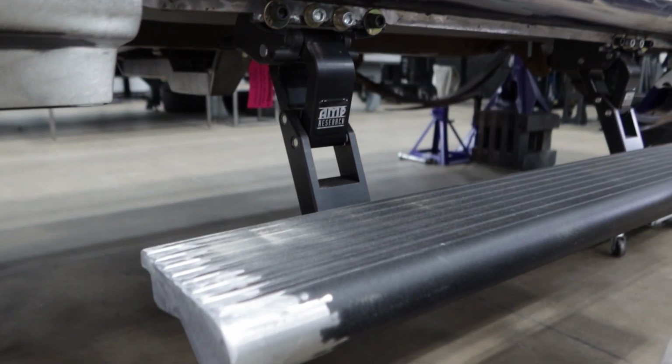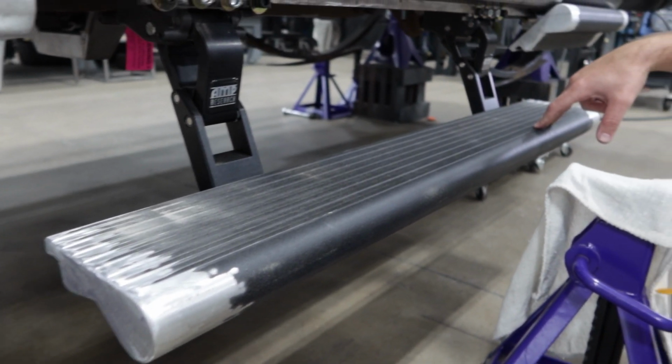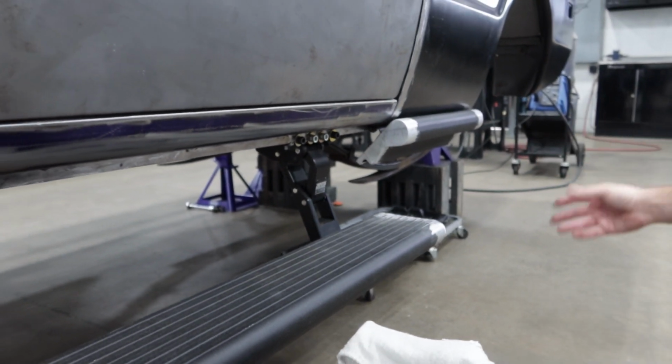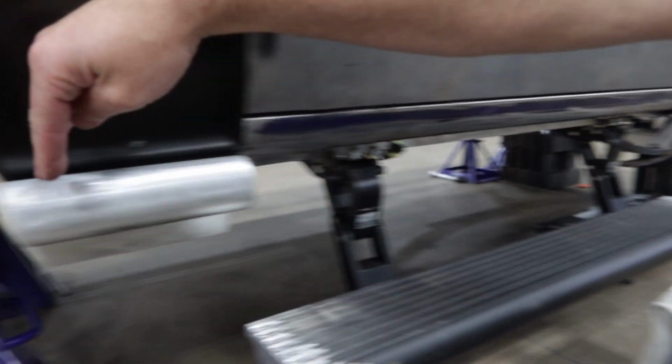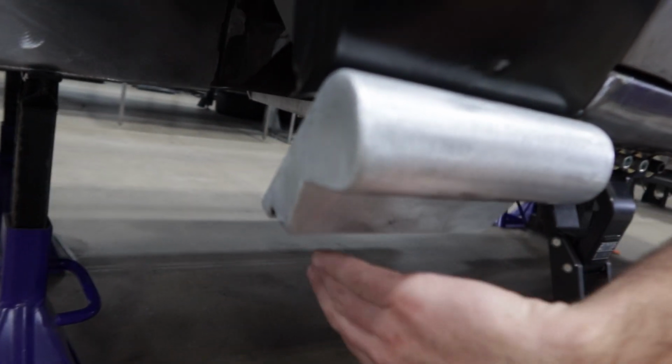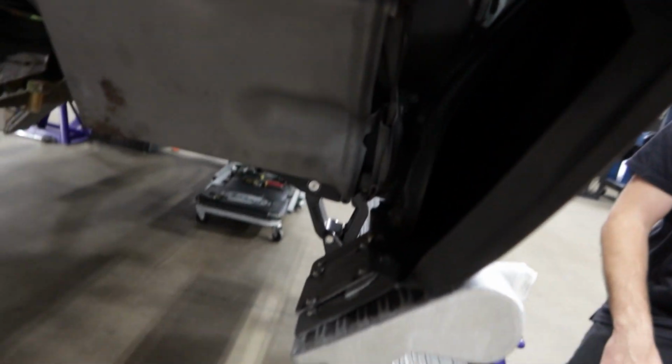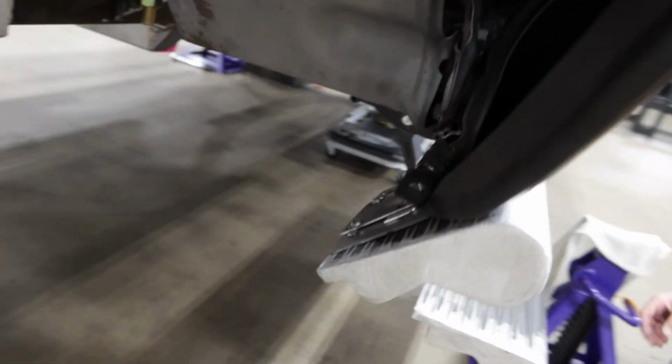Yeah, what were these originally made for? Like a Jeep Wrangler? Yep, right? Yeah, four-door Wrangler. They were a little bit long, which we were cutting them all up anyway. The ends actually got scalloped back a little bit, so they've got a little bit of angle on them. Boxed everything off. It had plastic end caps, which we just welded and metal finished.